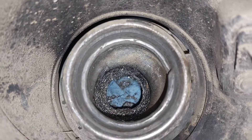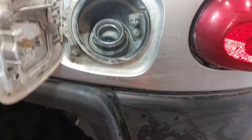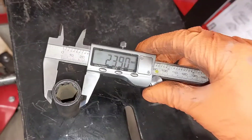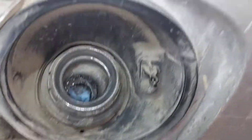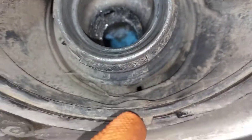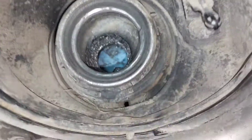It's all bored out. A diesel fuel pump nozzle is 23 millimeters outside diameter. I got my 16mm socket which measures just under 24mm and it fits, so I don't have to bore it any bigger. I just have to clean all the metal filings up with a rag, then vacuum as much as I can and blow the rest down with shop air.